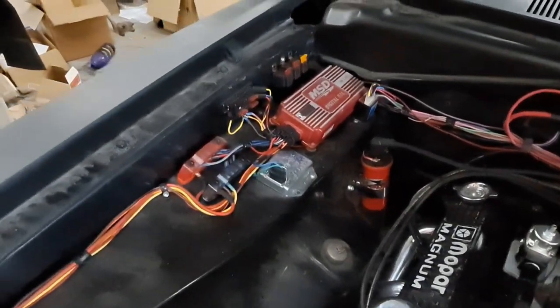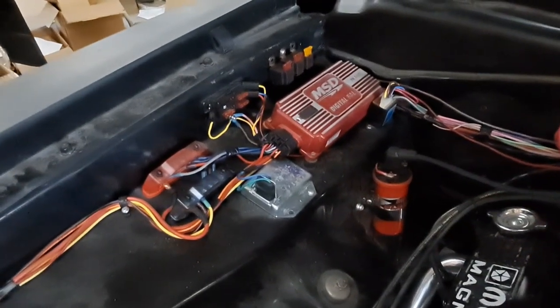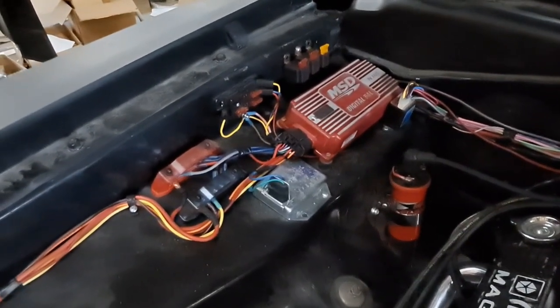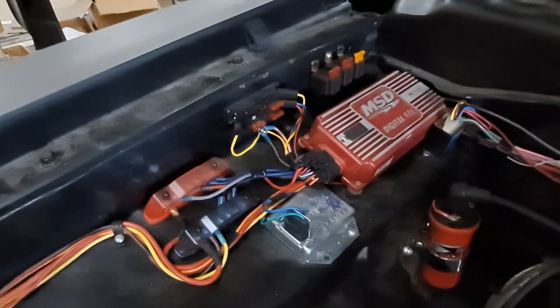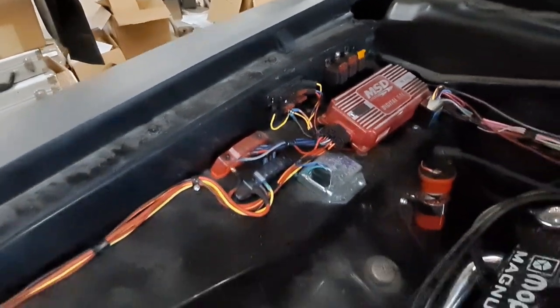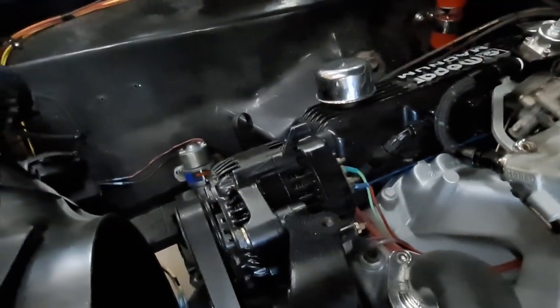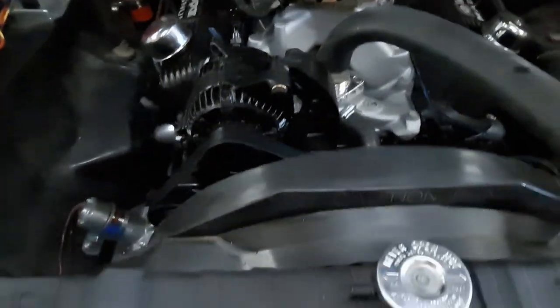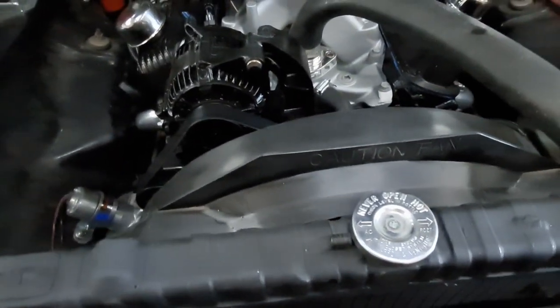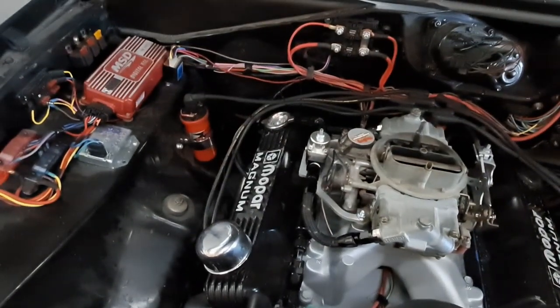If y'all saw it live the other day, no, we didn't have a key. We were missing power while cranking over there, and remedied that. Also, the alternator wasn't charging because I wired it wrong. Fixed that. She's full of water and some water wetter, oil, transmission fluid.